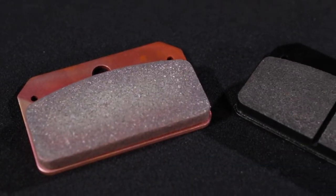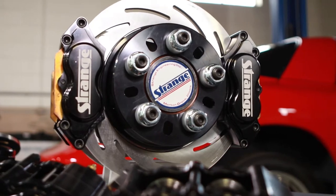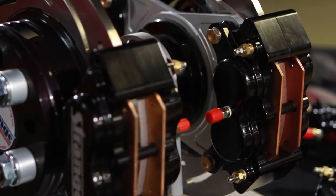When it comes to brake pad technology for holding a car on the line, you don't have heat coming into play yet, so a big concern is purely friction. On the front brake pads you want basically a soft metallic — that's going to have the best gripping force onto the rotor. It's also going to vary whether you're running a single piston, two piston, or four piston caliper, as you're increasing the clamping force and the surface area.